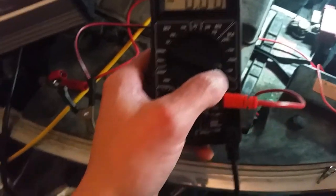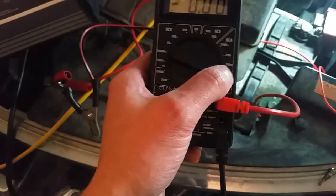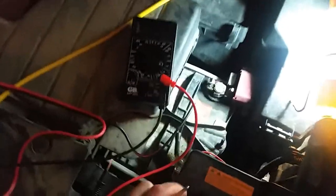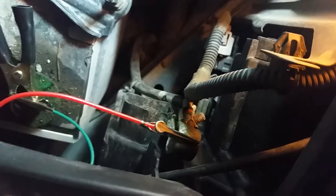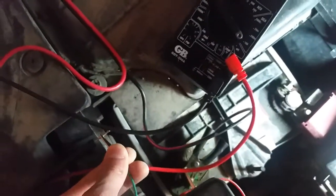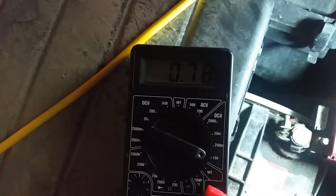The reason we want to set it at the 10 amp setting is we don't want to blow a fuse in case there's a higher amperage going through the battery. To free up my hands, I'm gonna connect alligator clips — one to the red lead on my multimeter and the other end to the post that the clamp was sitting on on top of my negative post, and connect the other alligator clamp to my negative lead on the multimeter. That should give me current.